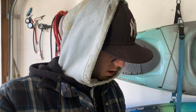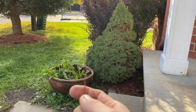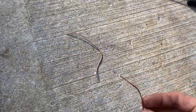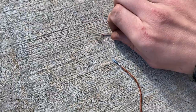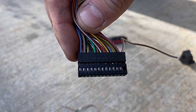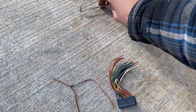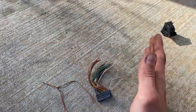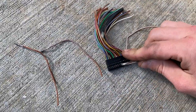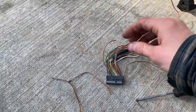I got a bunch of these switches at the junkyard and I'm going to snatch one of the pins out of these in order to put in our pin 23 and pin 8. If you're wondering how to remove these, you pretty much just grab a pick — the connectors have a little shoulder on them that pries against the plastic, just like the connectors on the brake switch. You just push and feed it up. If you're doing this, go to the junkyard and grab one of these — look how many I got, and I'll be saving them for other projects.